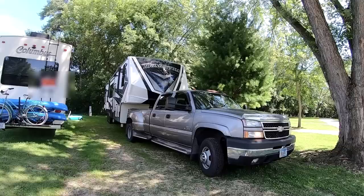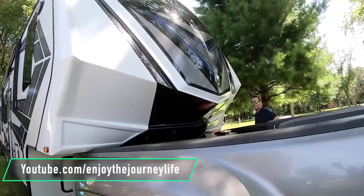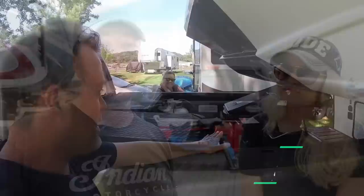I've seen a video of an actual pin fail where the RV drops on the truck — they were just filming because they had a new Momentum. It didn't really damage the rig, but it did a few thousand dollars of damage to the truck. The hitch can have all the proper indications that it's hitched properly, just like that — the pin popped out and said it was fine. This hitch has a white pointer that means we are in the locked position, safe to pull, which is a nice little safety feature on a heavier-duty hitch.